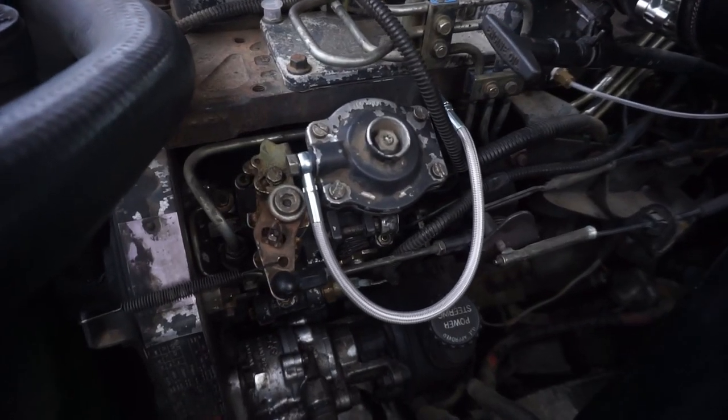And finally, we did a little bit of adjustment on the fuel screw, the smoke screw, and the star wheel to get this pump a little bit nicer. So there's probably a little bit more performance left in it with some more fine tuning, but I'm pretty happy with it for now. We went from a 13.1 to an 11.2, which is pretty fantastic considering it's still a dually — we're still hauling around a bunch of weight, so I'm happy with that. EGTs are much better than they were since fixing the boost leaks, and overall this is just a much better running truck. It gives you an idea of what you can expect as far as performance by doing these simple, pretty inexpensive mods.